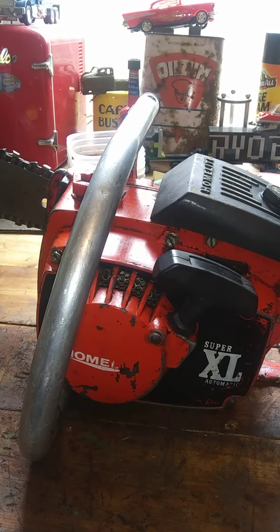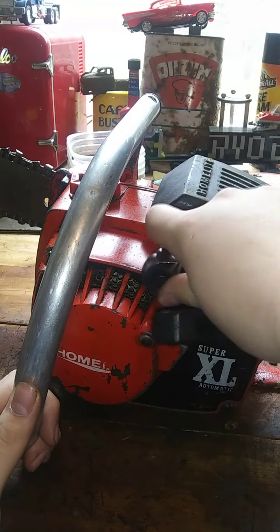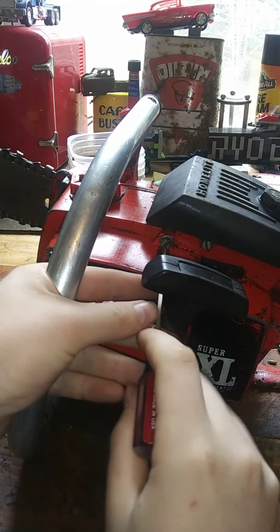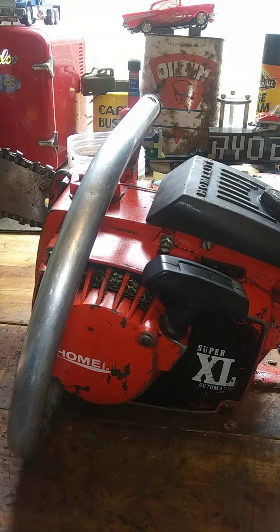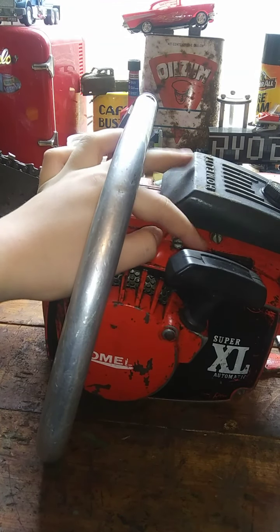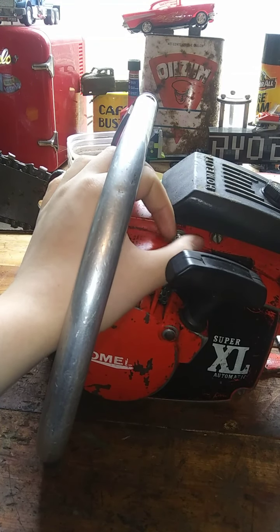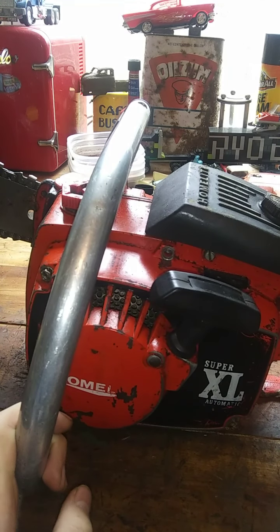Okay, guys. So, I'm back. Looks like it's definitely 15 thousandths. Yeah, that screw's definitely stripped out up here. I thought it was. So, yeah, anyway, 15 thousandths on that setting for the points. So that's pretty good, 15 thousandths, because that's what I said I was gonna set them to if I couldn't find anything. So Lee was actually, because you said you'd never really worked on McCullochs that much, comparing it to a saw of similar age, he's pretty darn close on that figure. I mean, if it had been one of these, he would have been right on the money.